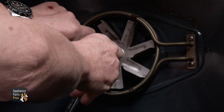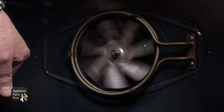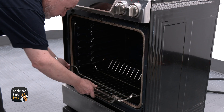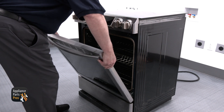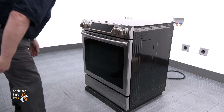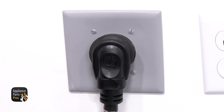The nut will tighten to the left. Then turn the fan by hand to make sure the blades aren't bent or rubbing the oven liner. After that, we can install the fan cover and put the racks back in and install the door. Make sure to push the hinge clips back up into the cabinet. Then open and close the door to check that it's opening and closing correctly. Don't forget to plug the range back in or flip the circuit breaker back on.